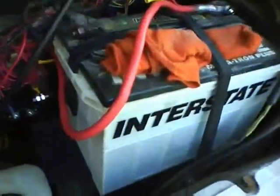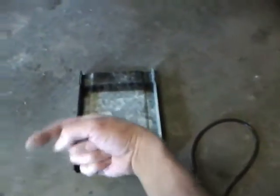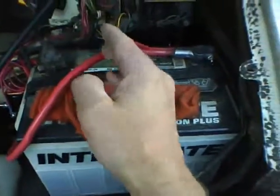The distributor and the battery tray — I had some of this laying around, just some chunks of metal. I took this stuff, cut it off the trunk, and ended up with this. I bent this out flat — this one here is too short, but there's another one already mounted in there. I bent it flat, drilled a couple of holes to match. There's a bracket underneath the battery tray right about here and I just drilled a couple of holes.